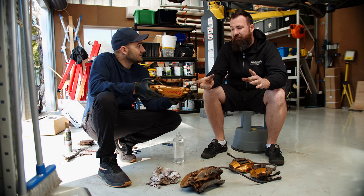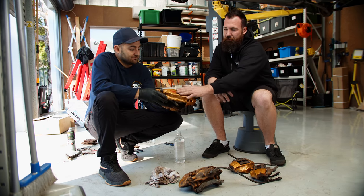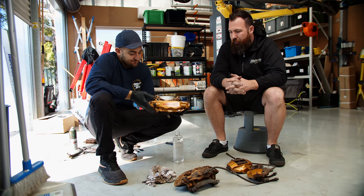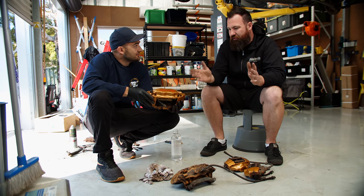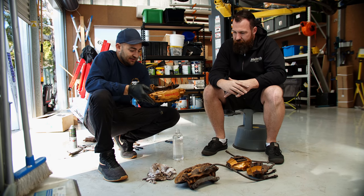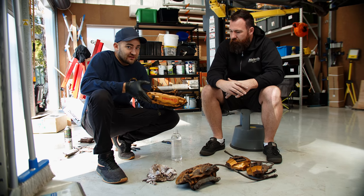They fit under some 17s. The thing people get caught out with is the spoke clearance to the outer edge of the caliper — it hits that. I see a lot of people on the net ask what offset clears Brembo's, but the short answer is offset's not relevant to the caliper, it's actually the spoke design. The good news is, because we put the hubs in from the later model STI, these just bolt straight on.